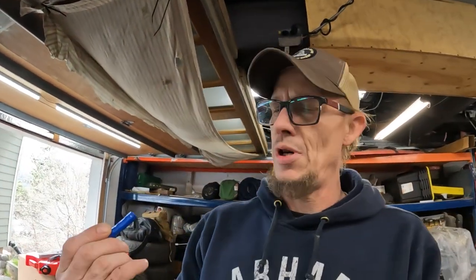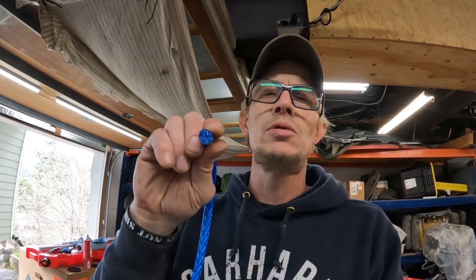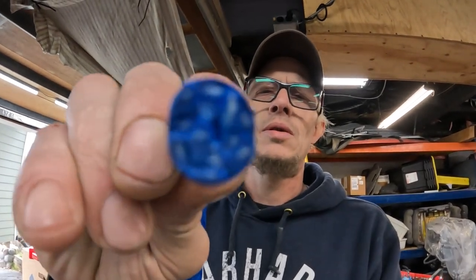So for those that you don't know, this is Amsteel Blue, 12 strand, 3/8. This piece is about 110 foot long. We obviously lose some as we terminate the ends. I think for shits and gigs, what I'm going to do, instead of putting a bolt down or tying a knot, I'm going to actually just run a regular splice around the drum so it can't come off, period, and then spool it up and then put the thimble on the other end.